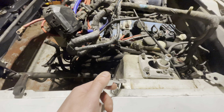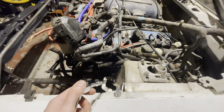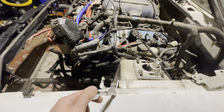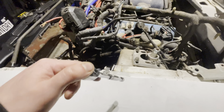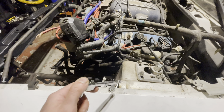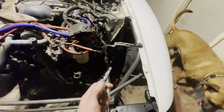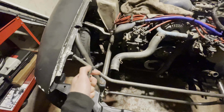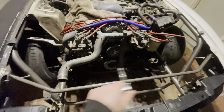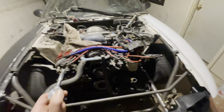I didn't cut on 16 and a quarter. I cut like 16 and a half-ish, somewhere around there. Then I mocked up the front end. There are two bolts on the outside here and the same thing on the other side that have to line up, and that'll give you your perfect distance. Another thing too: when you do something like this, you're going to want to make sure it's level from left to right, and you also have to make sure it's level from front to back. Check this rail front to back, that rail front to back, and then across them. Remember, we leveled the car, so you have to level the car to achieve that.